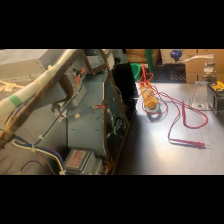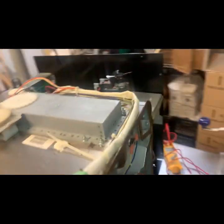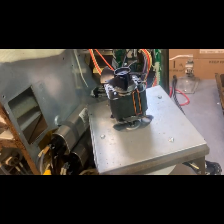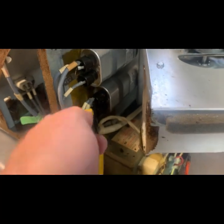There's a lot that has to be transferred so I'm going to spin this thing around and get a better look at it. Unplug it, and then we'll go step by step. First things first — I'm unplugged, but anytime you're doing anything, discharge the capacitors on these things.